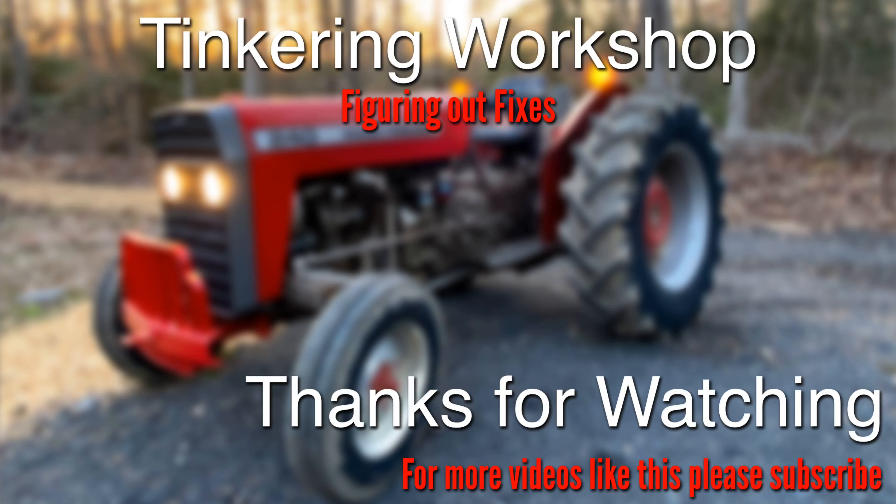We'll see if this starts letting the battery charge, because right now it's not charging when the engine's running without this. That's showing it's not putting power through. We'll spin the alternator a little more to see if it gets the power it needs to shut the light off. Once I got about 1200 RPMs this thing went out - it should stay out because now it's sending power through. It's dim but basically out, so that's a good sign. Let's get the voltmeter and test.